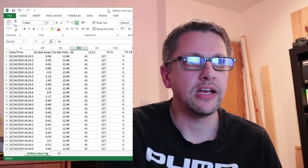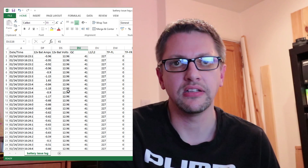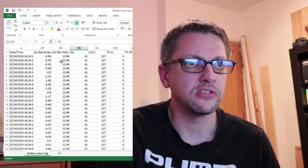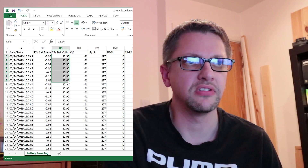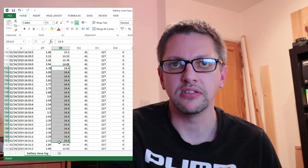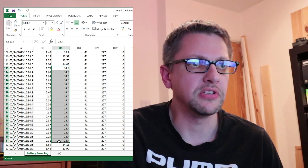I used LeafSpy and went on a short drive around the area — it logs all the values it can see: speed, distance done, state of charge, and the 12 volt battery voltages. If you look at the screen it starts at 12.96 volts, which is fine. It did go up to 13 at some point. Scrolling down further you can see a whole bank of 14.4 volts, which means the battery was actually charging as I was driving. So that's another good sign.